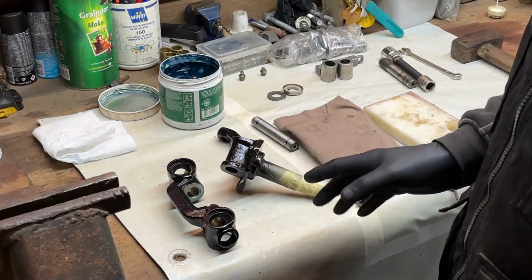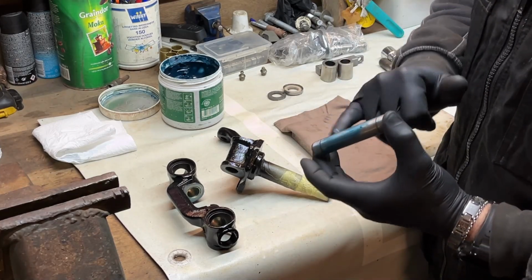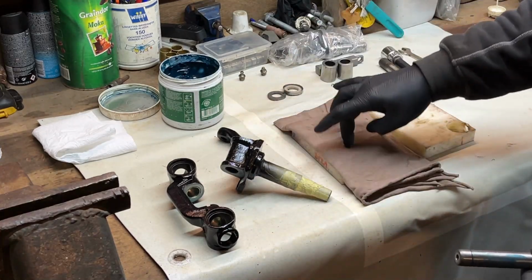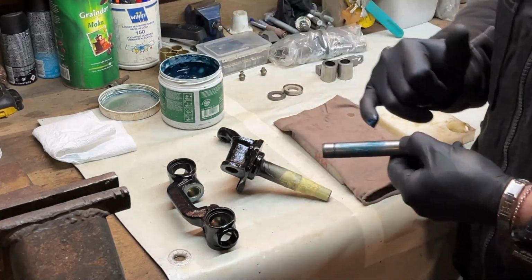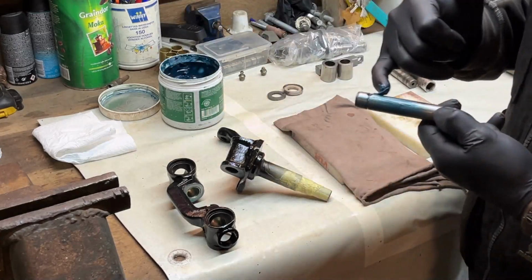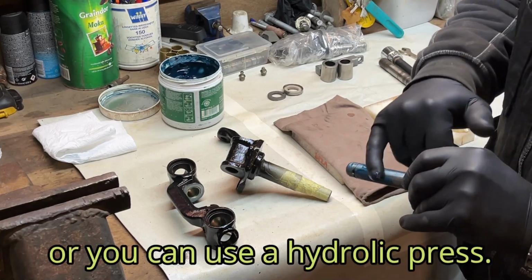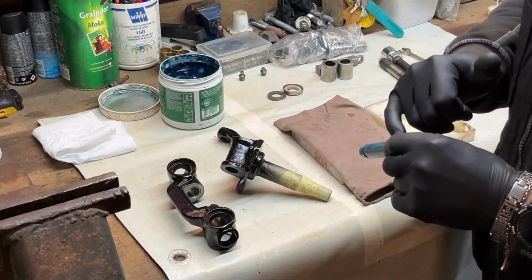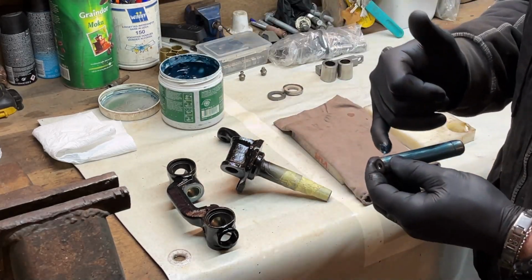The thing that we don't want is that the paint will chip. So to put that pin in, I take a rag and the Teflon plate. You can take wood. Don't take soft wood because you need some hard surfaces to tap these pin in, because it will take a little bit of strength to take it in. But with that, your paint is a little bit secure for not chipping off.